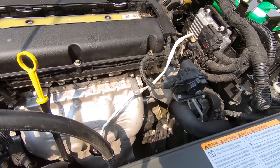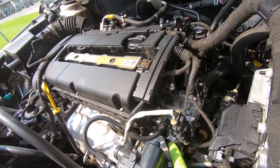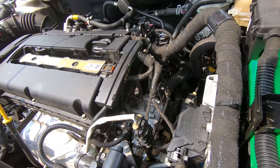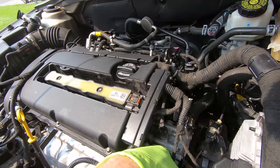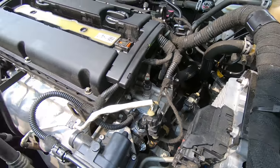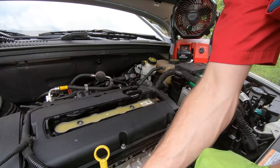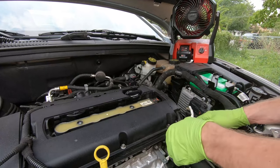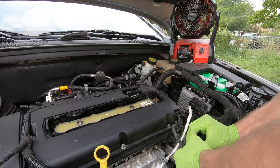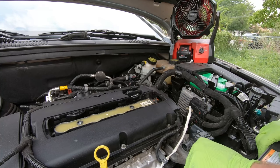Now that the sun has hit right there I can see coolant — I'm guessing that thermostat housing up there. I also see one of these adjustable hose clamps here, so I'm going to check the clampiness of that. It could very well be this joint right here — I believe that's probably the thermostat back there. We definitely have a leak here. What led me to it was just these two drips right here. We didn't do anything wrong taking this stuff off because it connects right over to where we're working.